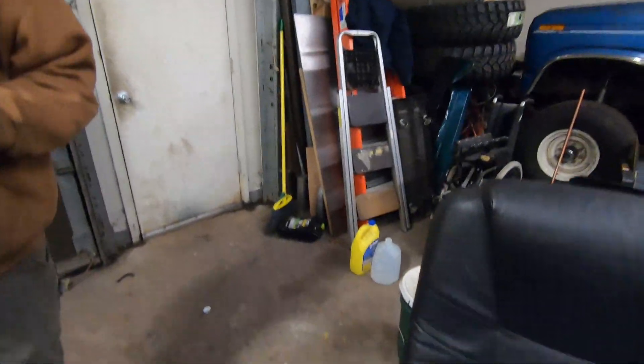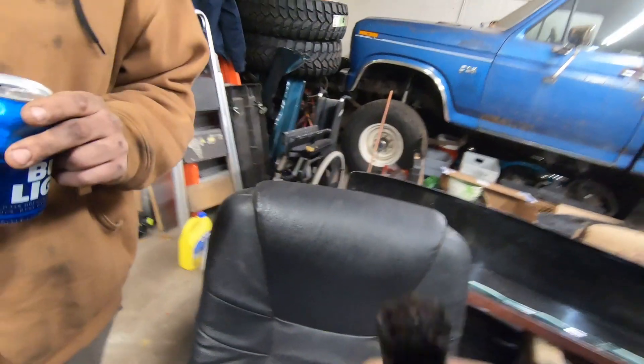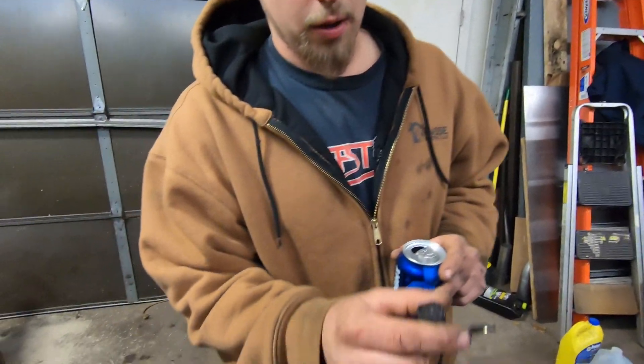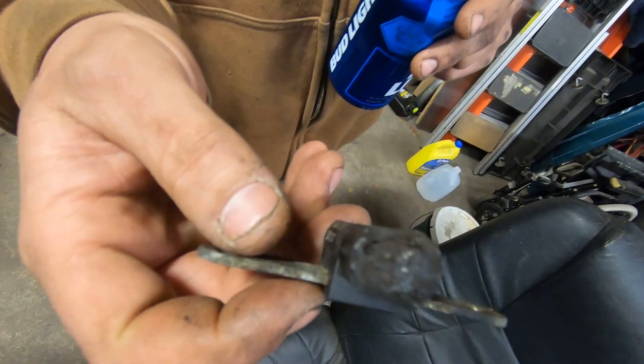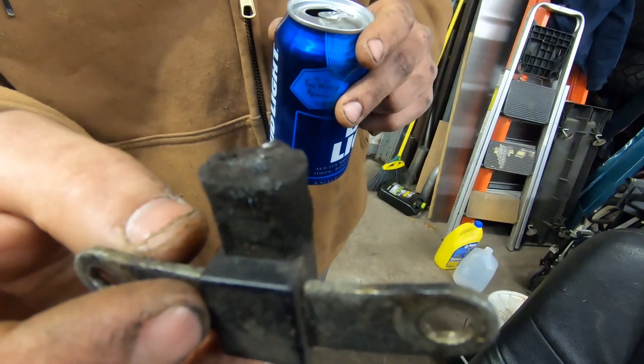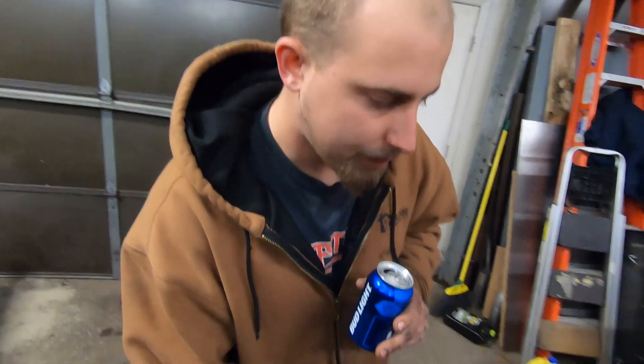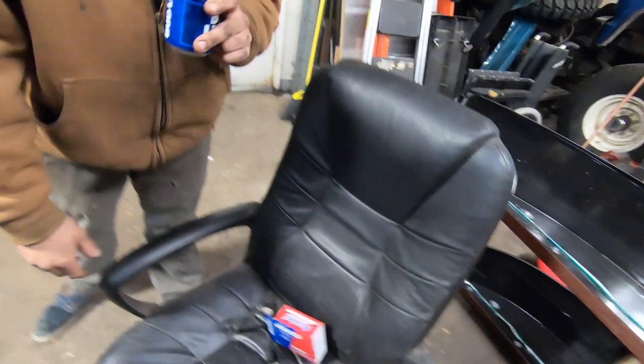Tried to do a pull and lost crank signal. We took the crank sensor off — wiring looked fine, everything looked good. We discovered it was pretty old and crusty, looks like it might have melted or gotten pretty toasted at some point. We figured that was the problem, ran to the auto parts store, got a brand new one, slapped it in — eighty bucks later and same issue.